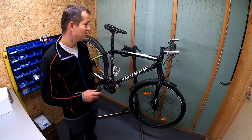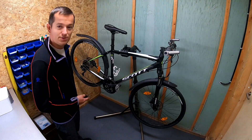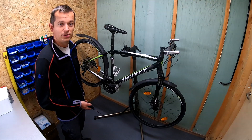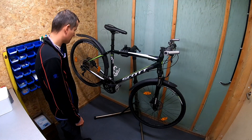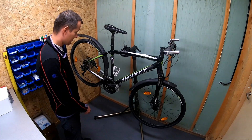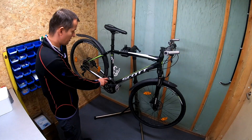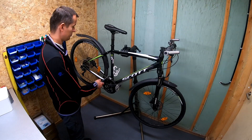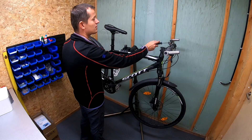Today is the next day of changing this patient to the electrical bike. I'll just show you quickly what I'll be doing today. First of all we need to prepare this bike for cleaning, so I'll disassemble all the unnecessary parts. The first thing is the heart of the bike — the chain ring with the chain. We will replace this with the motor, so we will not need this anymore. And we will remove the front derailleur and the gear shifter.